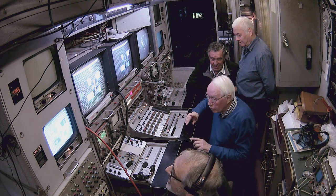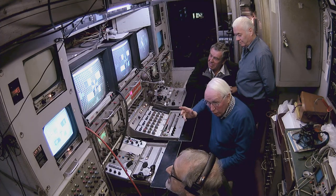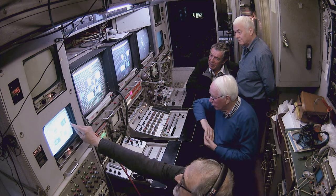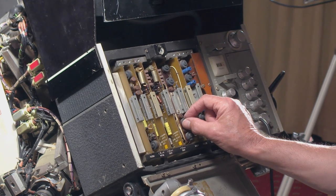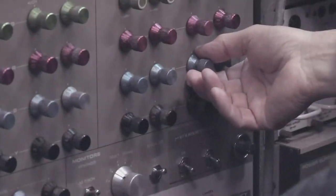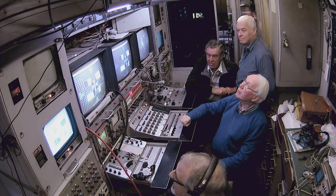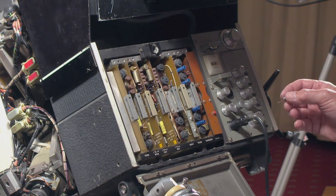Go back on that, Robin, please. So what we've done now is we've got it more or less right along the vertical on the centre. Do you need a bit of blue skew? There are other adjustments to try and get the corners in. What about the verticals? Blue skew? You could try the blue skew, yeah. That's it — that's bringing that. You see how it went in the centre there, and there's also a linearity problem on that side.